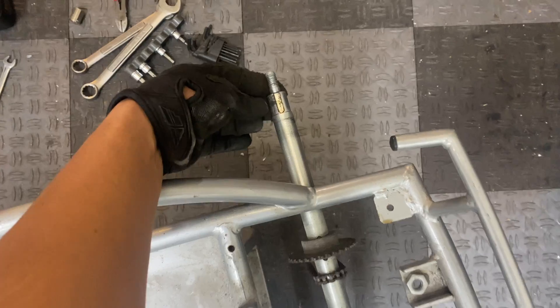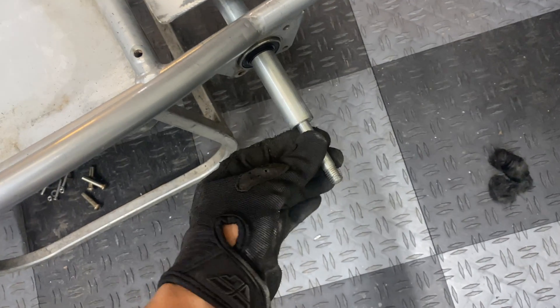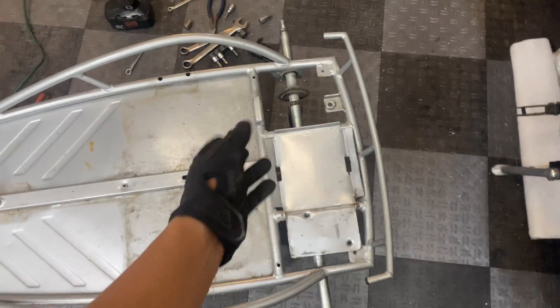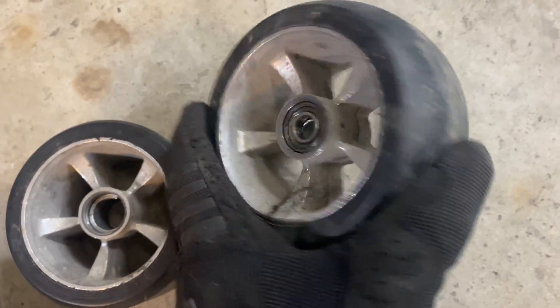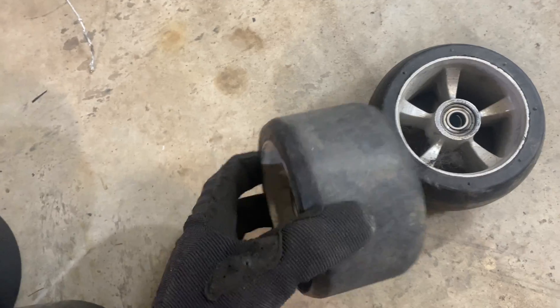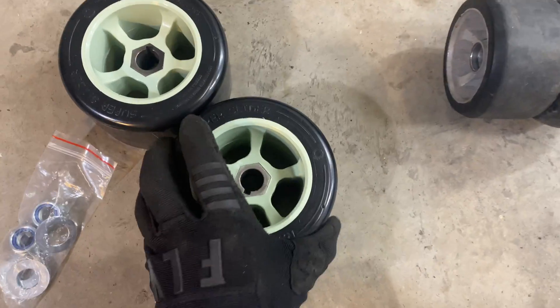What I found shocking is this disgusting amount of hair curled up into the rear axle on this side — look at that, that is gross. I cannot wait to get rid of this and toss it in the trash. That was probably messing with the bearing on this side. This is what I was talking about as far as the non-live rear axle — on the right side there's a keyed portion that locks the right wheel; we do not have that on the left side. So I'm probably going to have to get a sleeve welded and fabricate a key to make sure that both rear wheels break loose whenever we're hitting the throttle, kind of like having a welded diff on a drift car. The left wheel is just riding on bearings, while the right side has the keyed portion locked with the rear axle — that's why it's wearing down faster.